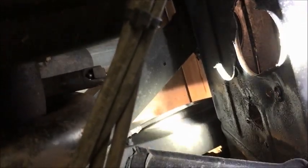And this column will actually end just outside that hole. I'm trying to get down here where the hole is, just barely. Just by eyeballing where everything's going to line up, it's looking like I'm going to need 3 U-joints, but I don't know that. I'm still just kind of guessing here, so I won't know until I get the new column in here and see where everything actually lines up.